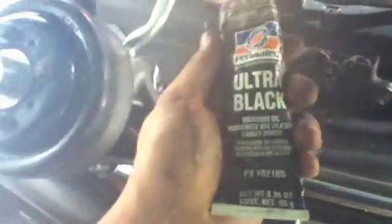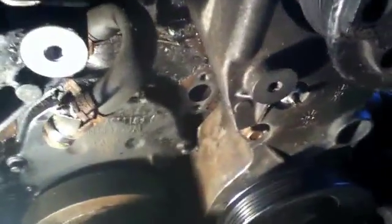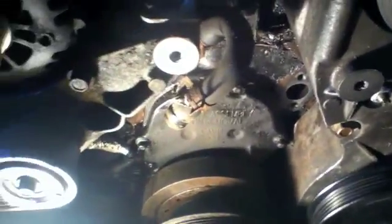So I got the old pulley off and put it on the new pump — there it is. Now I'm going to take this ultra black gasket sealer, put it on each one of those inlets and outlets, and put it on the other ends of these as well. Then put the gaskets on and bolt it up almost finger tight, let the gasket sealer dry, then crank it down. I'm going to do that and I'll check up with you guys after that's all done.